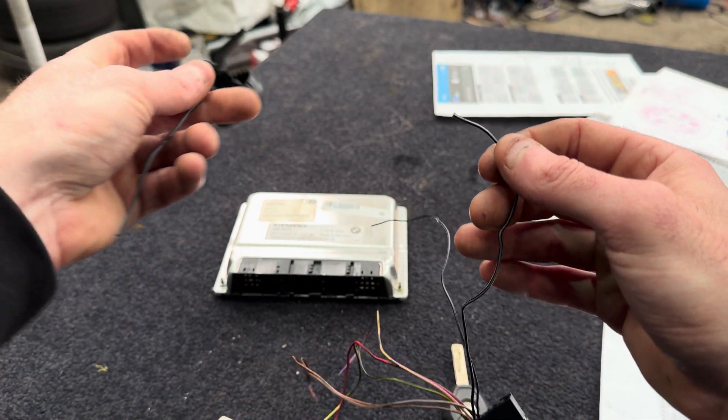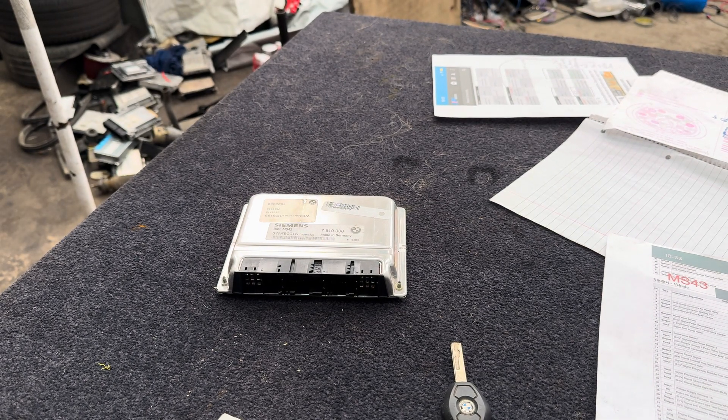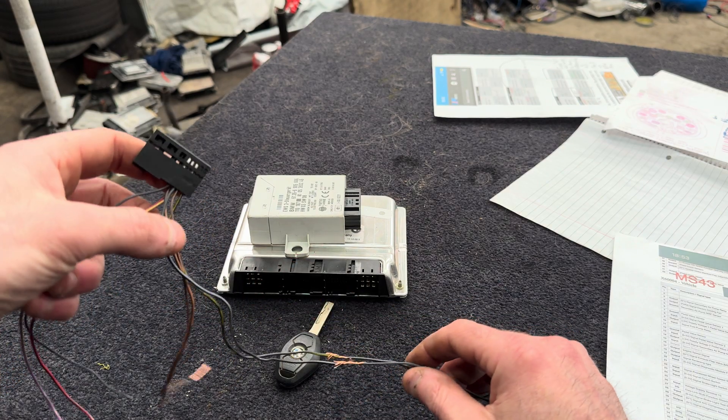The black with purple stripe is going to go to the ECU pin that's for the immobiliser. On top of that you've just got to colour match your antenna wires. The colours have got to be the same — black and yellow to black and yellow, and then black with a white and grey stripe to black with a white and grey stripe. So antenna wired up, colour matched — earth antenna connected.